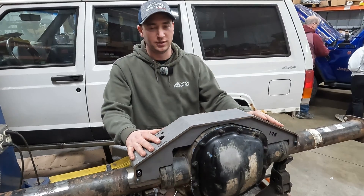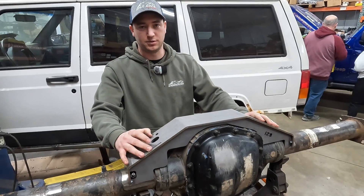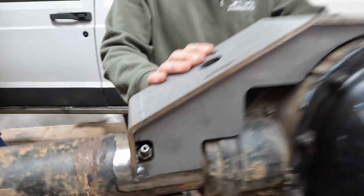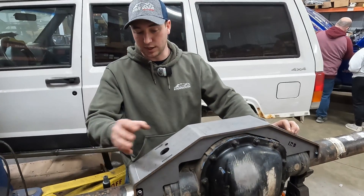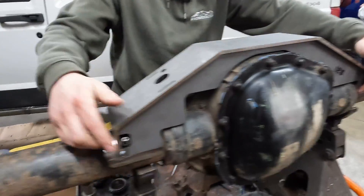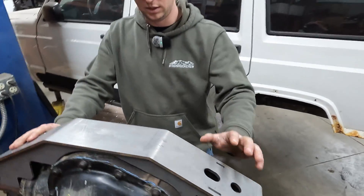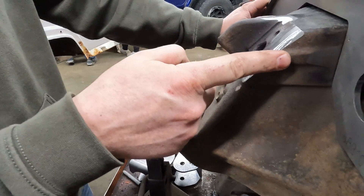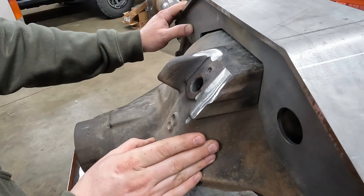Right now we have our four-link swap truss on here — simple three plates, all notched so they can only snap together one way. This one is tacked together right now just so we could test fit it. Once you've got it tacked together and set on there, you can go around and mark with a marker all the way around where you're going to be cleaning up and getting it ready for weld. On the back of the housing we did have to do a little bit of grinding — there's a cast mark that comes through, so we had to grind that flat so we had enough room to slide our truss in place.